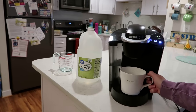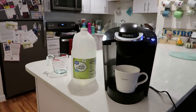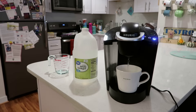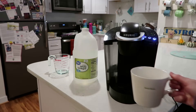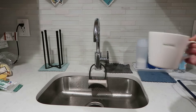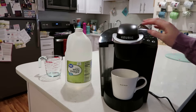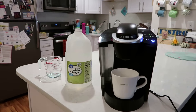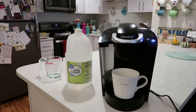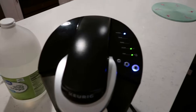I'm just going to run cups through until my Keurig machine tells me that I need to add water. Once you've run an entire new canister of fresh water through, you should be good and you have successfully cleaned and descaled your Keurig machine. I recommend that you do this process every three months, even if your descale light hasn't come on, just to ensure that you're keeping your Keurig clean and working as best as it can for you. I hope you enjoyed this video and are successful in cleaning and descaling your Keurig. If this method works well for you or if you try a different method, let me know in the comments below — thanks for watching.